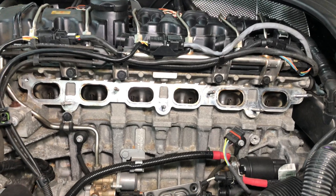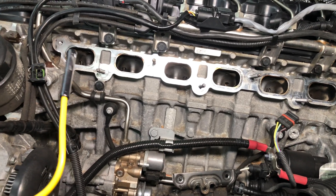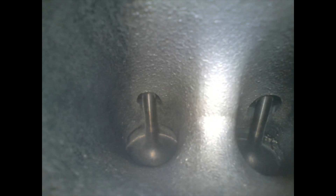That's been successful — we've cleaned all cylinders now. Here again with our borescope camera now we've finished this process. On cylinder number one, which was the original one we looked at, the air divider is perfectly good and reflective bare aluminium. The majority of the inlet track is all cleaned, the valve heads and the valve stems as well are looking really good — a nice strong radius there for the airflow to hit perfectly as BMW designed the intake.